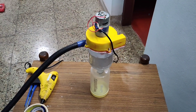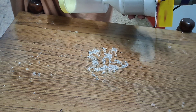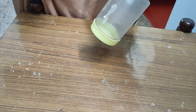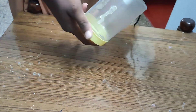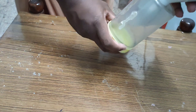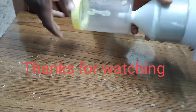Our 3D printed vacuum cleaner is completed. Now moving to the important part — testing. I have connected a 12V 10A DC power supply and I could feel a decent vacuum which can collect powdered dust. If you connect 36V to the motor, you will get a stronger vacuum. I have attached all the STL files with this video so you can download and try this at home.